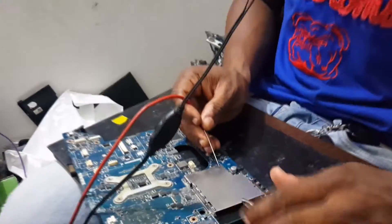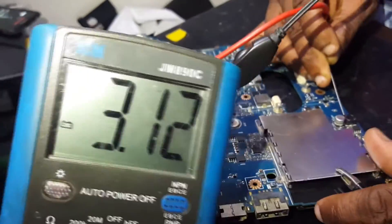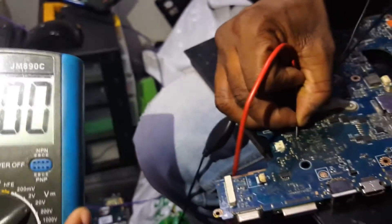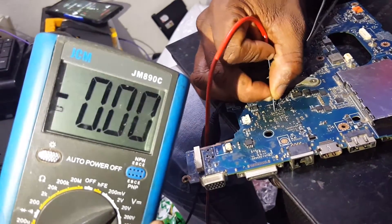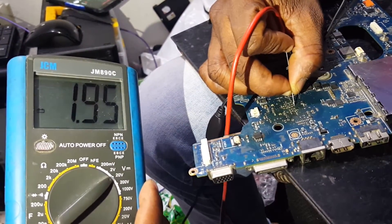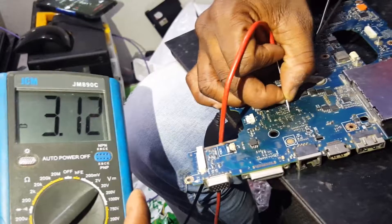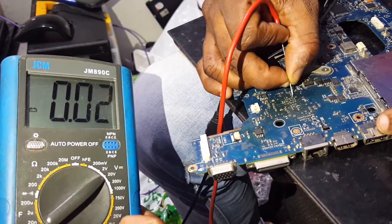This is the standby voltage for the PCH. You see these PWM voltages? These PWM voltages are going directly to the PCH. These are the PCH standby voltages. If you come to some of these resistors you will see 3 volts coming. Let's check around — these are 3 volts. You will find one 3.3 and 5 volts. These are hard to find without a valid schematic, but these capacitors are not labelled. This 3.3 volts is the standby voltage for the PCH.